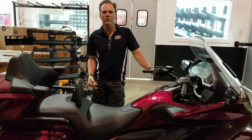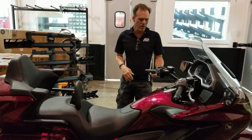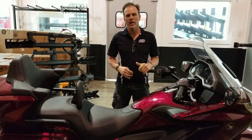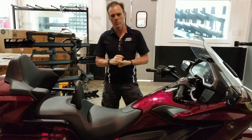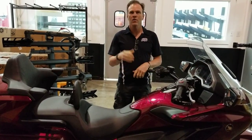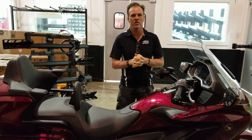The next step is in some way altering the suspension of the motorcycle. I recommend this last because you're now affecting the way the motorcycle handles and performs. Let's talk about the bad ways people do this first. Improper ways of lowering suspension: on a telescopic fork bike, people will take the fork caps off, pull spacers out, and cut spacers down. All that does is remove preload from the springs and lets the bike sag into itself, so the suspension works really badly.